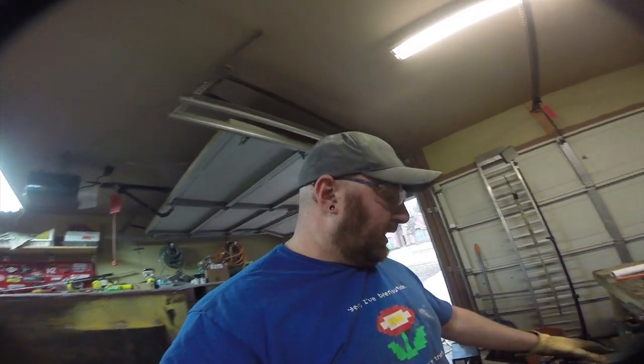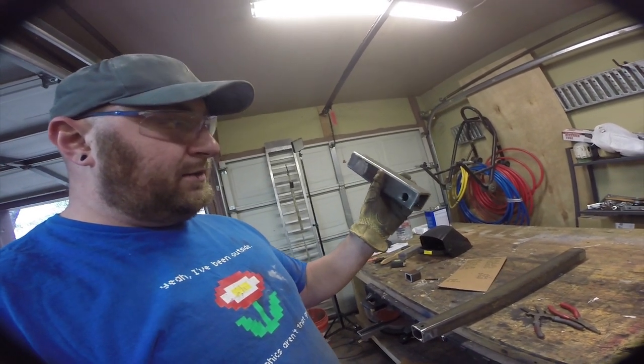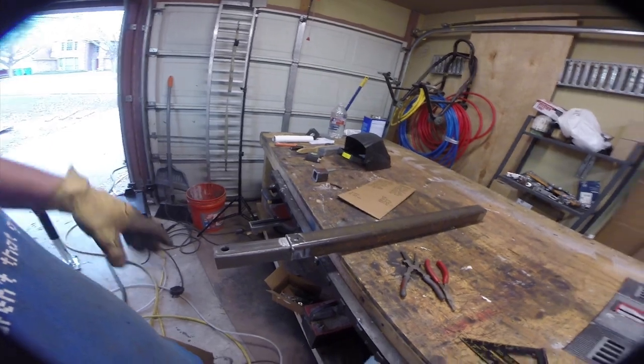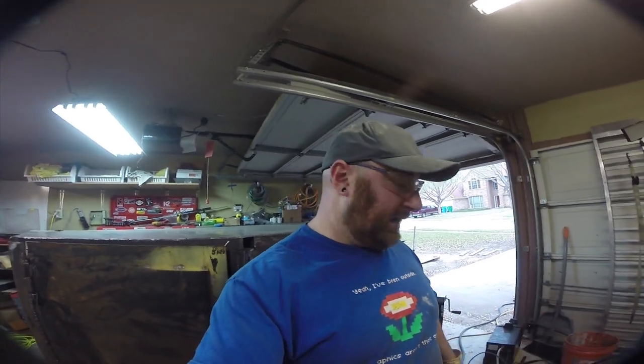The next step we're working on is building the trailer tongue. Basically what I do is I cut this — it's quarter-wall two-inch square outside diameter. These holes match the holes under here so this basically just slips in and locks in, which leaves us about two inches. We're using the same tube to give us about a 34-inch plus two over there — that's six inches plus five on the truck side — giving about 40 inches worth of tongue. My truck is about 76 to 78 inches wide, which means I can jackknife the trailer all the way without hitting the bumper. That's basically how you spec out a tongue.